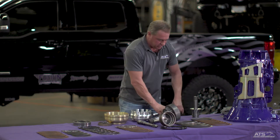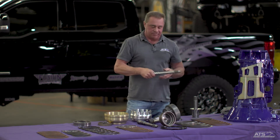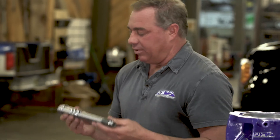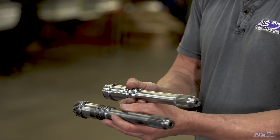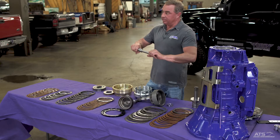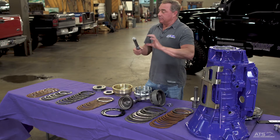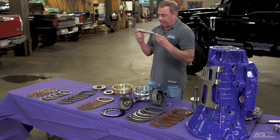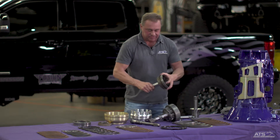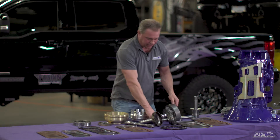When you start clamping all the clutches down so they're not slipping, you begin to torque on these components so heavily that it breaks the shafts. We have a billet shaft — this particular one is from the machine shop and doesn't have splines yet — but it's a piece of 300M. The reason we build it out of 300M is because of yield: if you go beyond a certain yield — meaning the material doesn't return back to its neutral shape — you begin to create stress risers and then it blows up the shaft. That happens in the input shaft, the forward clutch hub, the overdrive clutch hub, and ultimately the output shaft.